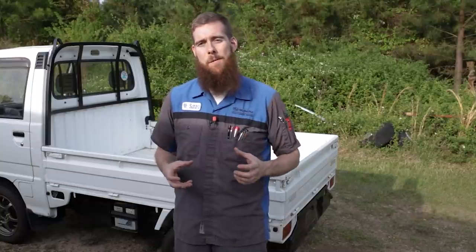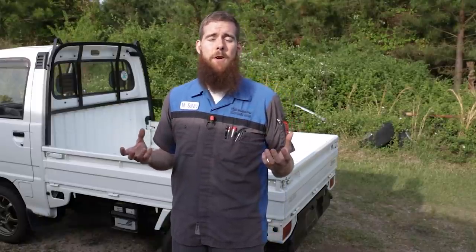First of all, we're going to get the AC machine out. A lot of you are probably thinking — DIY man, what are you doing with a $6,000 AC machine? We don't all have one of those in our garage. AC work is not very DIY friendly. In accordance with state and federal laws, you can't just release your refrigerant — you have to recover it. So you either have to go to a shop and have them recover your refrigerant before you start diagnosing your AC system, or you have to have the equipment yourself.